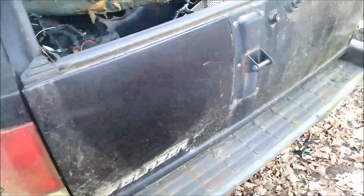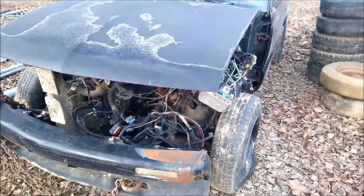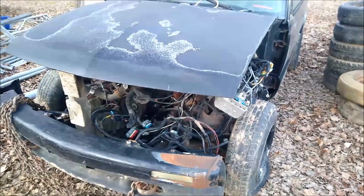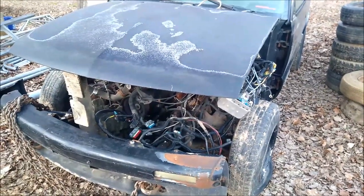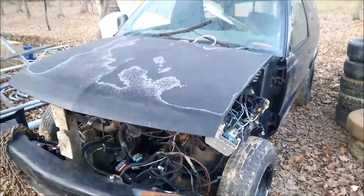I had the taillights working. I actually had both taillights working in it, and sorry, I just had a thought. These might have the right sockets that I need, but I used some newer sockets that had a grounding wire instead of grounding to the lens housing. Anyways, I had both lights working, and then I touched another contact and everything went dead. The fuse block and everything. And I had that problem on my '59 and I ended up having to put a whole new wiring harness in it.